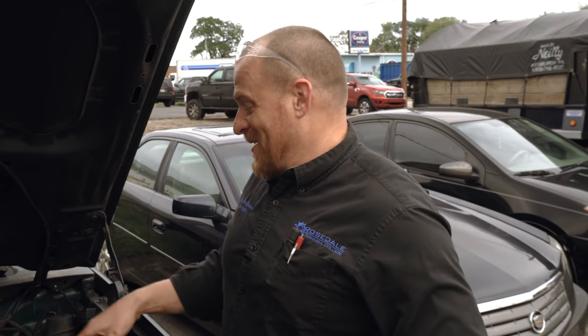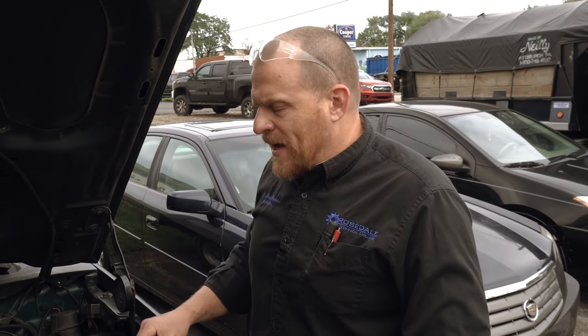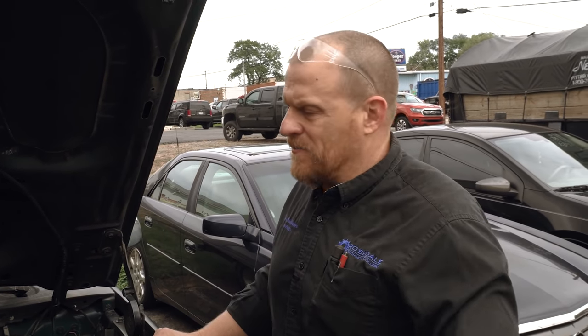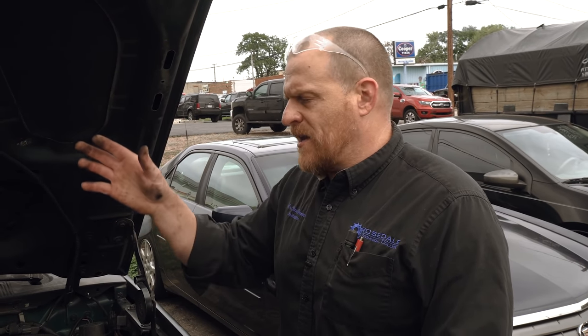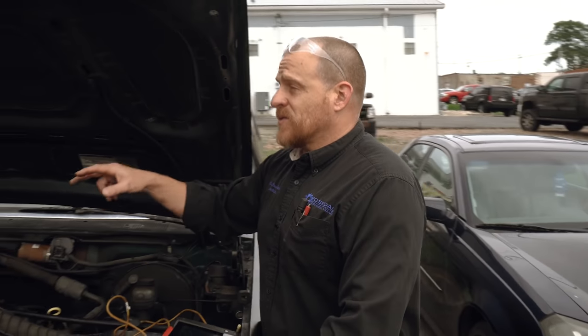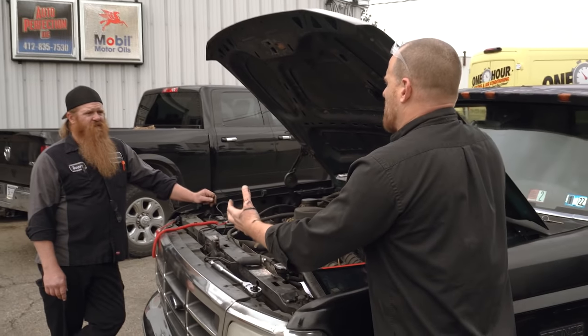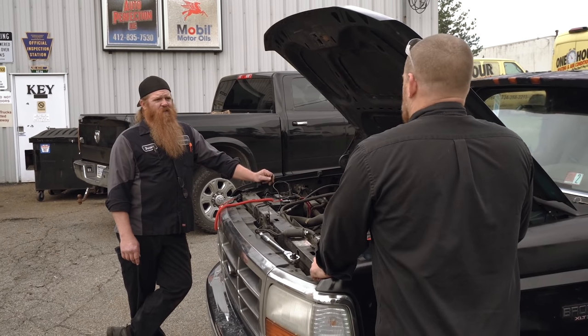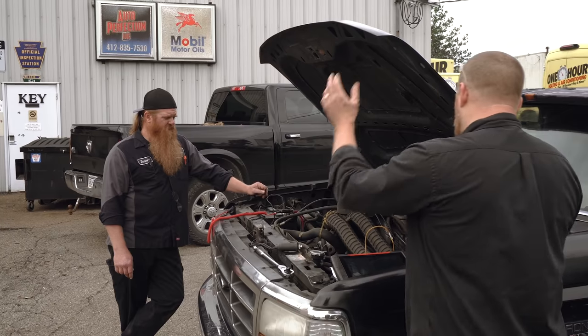That was my guess. They did everything else — it does have a new coil, a new module — but it could have been a wiring problem. I put my test light to battery positive, touched the PIP, and I made it spark. After I did that, I fired it right up. That back-feeds the Hall effect and can wake it up, which is exactly what we had. I'm not checking powers and grounds because that wouldn't fix a power or ground problem — I made spark without the Hall effect even spinning. The only variable would be a lack of power or ground to the Hall effect, and those wouldn't suddenly come back from me exercising the PIP signal wire. Signal side — that makes sense. So put a distributor pickup in this, we're done.